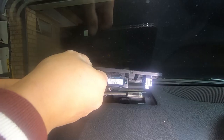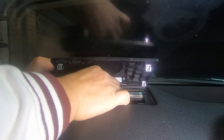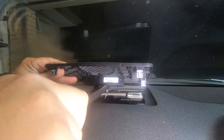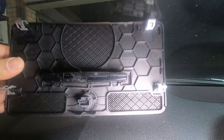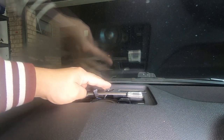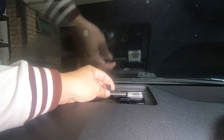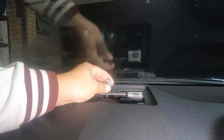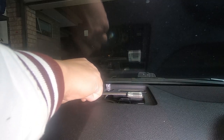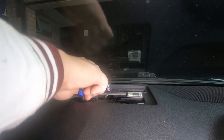There's the plug for your parking sensors — just pull that one straight out. For the second one, there is a tab on it; use something like a pick tool, press on the clip and then pull it down — that's released. For this one there is a little push clip that you need to press in order to release it.